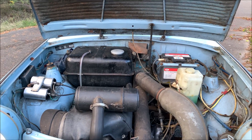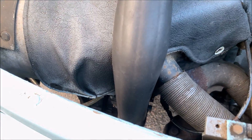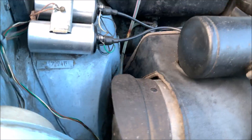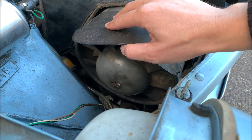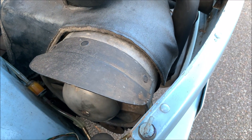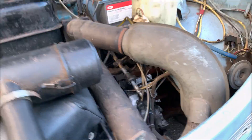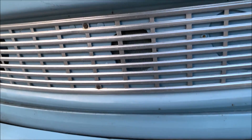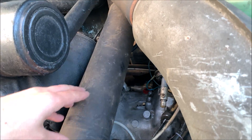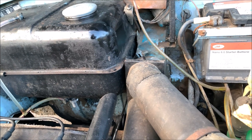In the engine compartment we can see the air intake underneath, blowing air towards the engine cover. The big fan is sucking air for the air cooling, guiding it through the cylinders, and blowing it out at the bottom — a very simple cooling system. The other air intake for the interior has a little net and then a straight pipe going directly into the interior — yes, the Trabant is straight-piped.